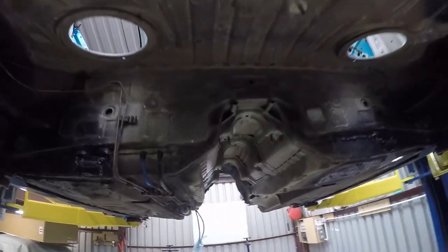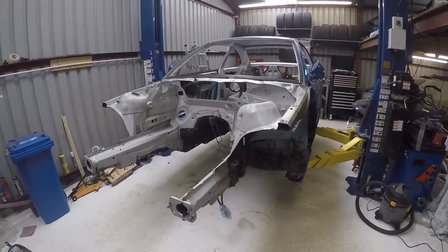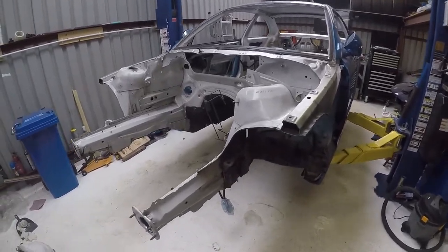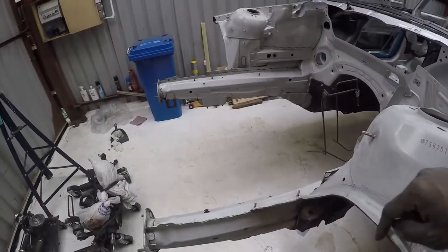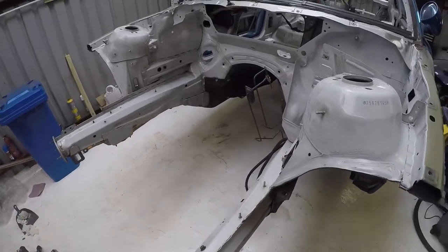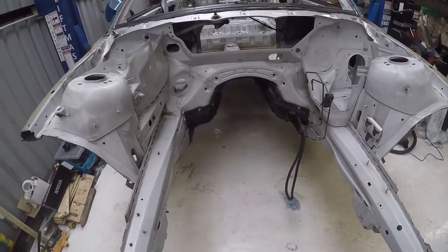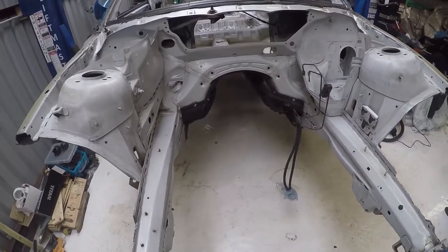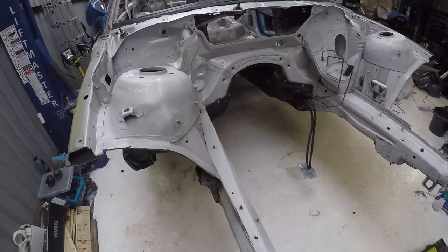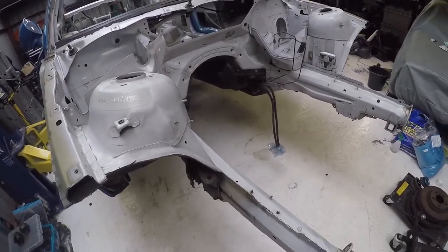The inner arches have been cut away for a bit more clearance on lock — essentially this part has been cut just forward of the front struts. The engine bay has been cleaned and degreased ready for painting. The intention is to use some white POR15 — I've used it before and it seems to be quite good and hard wearing, so I thought I'd give it a go again.